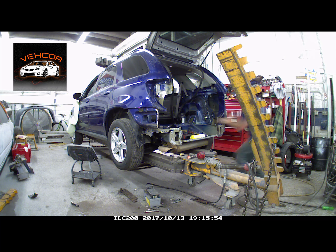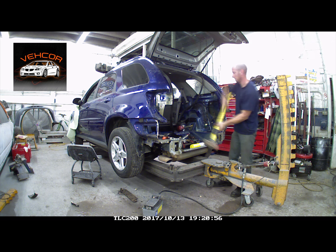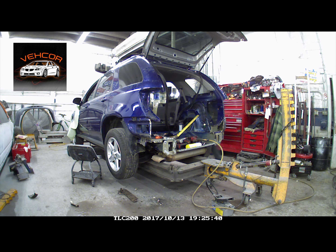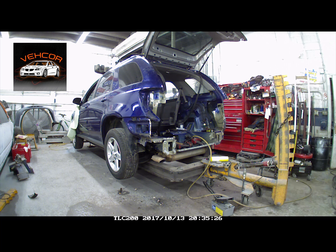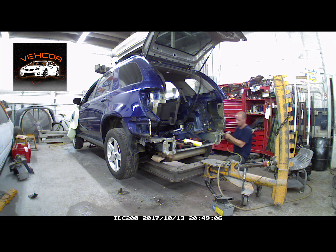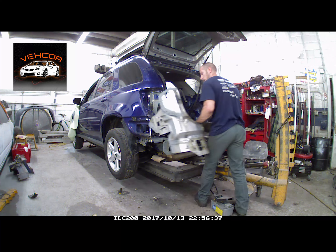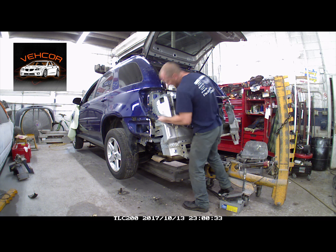Now we're trimming out some pieces. I didn't like where the opening was, so I pulled that out a little bit to fit the tail light a little better. Then we trim out the rest of the pieces in there. We put weld-through primer on and get it all ready for the new piece. We put a friction jack in there to spread it apart, making it a little easier to slide the panel up in there.